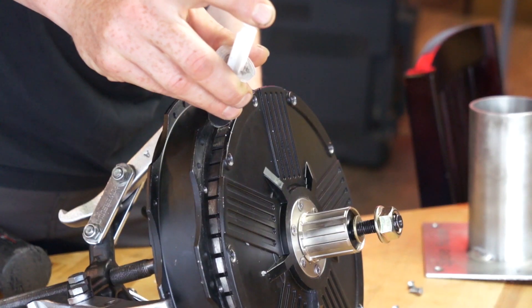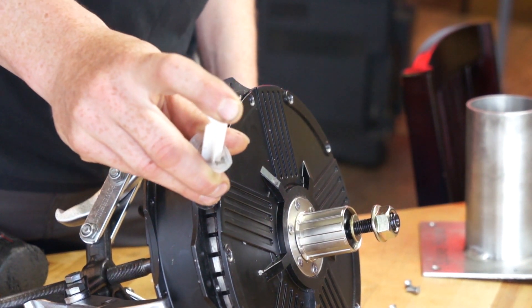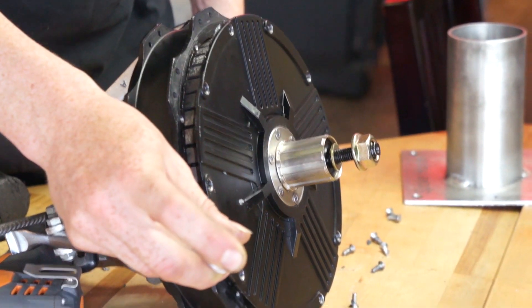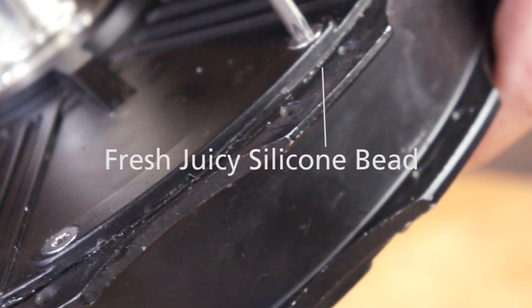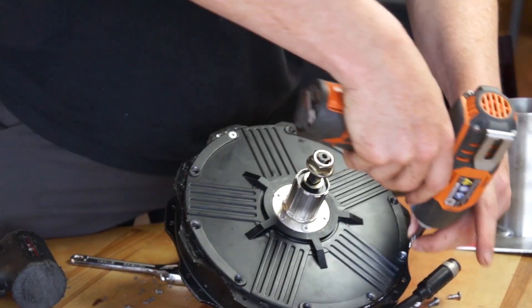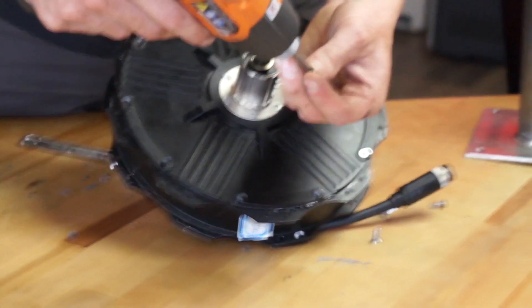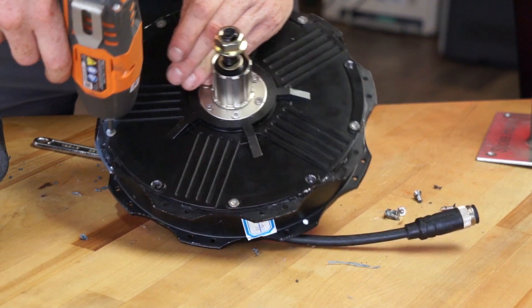The silicone I'm using here is a black RTV. Black is convenient because it blends in well with the black motor side cover. You can honestly use just about any silicone sealant from the hardware store — it does the job just fine. When you close the side cover you'll see the black silicone ooze out. When driving the bolts back in, I still use an impact driver but be careful not to overpower it. The Torx head is quite strong and doesn't strip easily, but you're going into aluminum threads in the rotor of the motor, so be a little delicate. Use the usual practice of staggering the insertion of the screws.